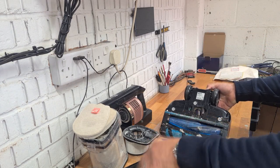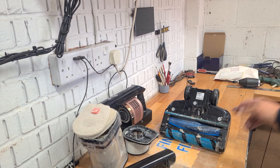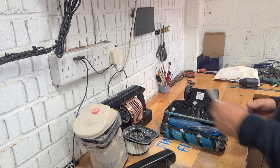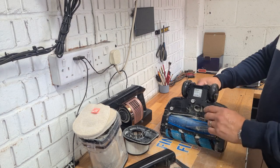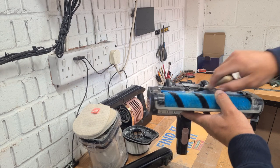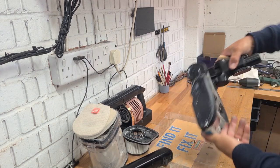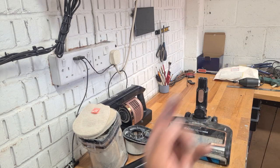And then once you flip it over upside down and get to the brush bar — doesn't matter if it's a hair wrap brush bar or whichever brush bar it is — you've got three here. All you do is just unlock them. We always use the butter knife — just twist, unlock, unlock, unlock. Lift the cover off and then you can see inside here. Again, this one's blocked up in here. This machine is absolutely filthy, so I'm going to do a full deep clean on this machine in the next video. If you'd like to see that, watch the video in the box over here.